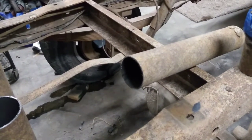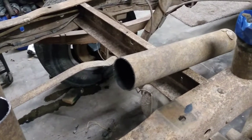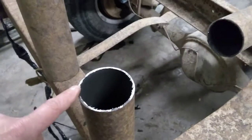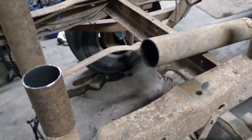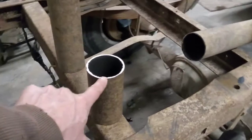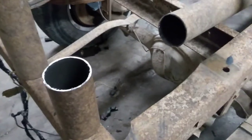But by doing those things, being careful with my welds, probably grinding them down so that they smooth out good, then I should be able to retain the balance of what I'm doing here, as long as I don't cut too much out of this piece for that slot, so that we lose metal there and it causes that to be a light spot on the flip over part of it. And we might do that, but that's the objective, is to try not to. So there you have my 3 pieces. Once I get this sleeve cut, I will show you what I'm talking about so that you can see how it goes together, and then we'll go from there.